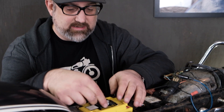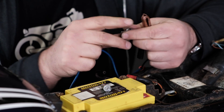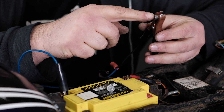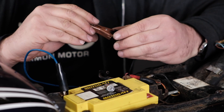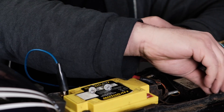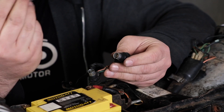Let's test out these LED gauge bulbs. I'll use my jumper back at the battery. The bigger metal part of the body should be ground or negative, and that little tiny tip in the middle should be positive. I'm going to connect the jumper touching the body to the negative side of the battery, then touch the little tiny tip to the positive side. Nothing — that bulb is dead. Let's try this other one — I feel like it's dead too. And nothing. Both of these LED bulbs are bad. I have an incandescent bulb here to show the same test — grab it at the body, and there it is, lights up. This incandescent bulb is good.